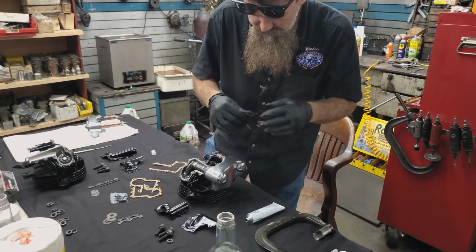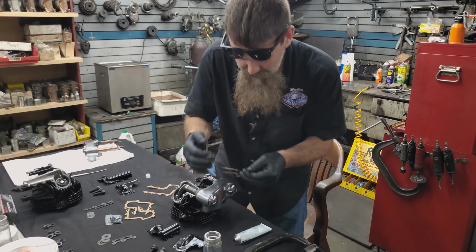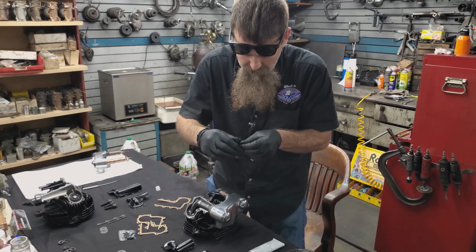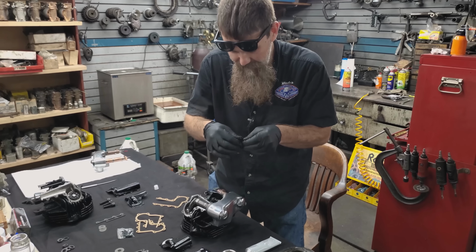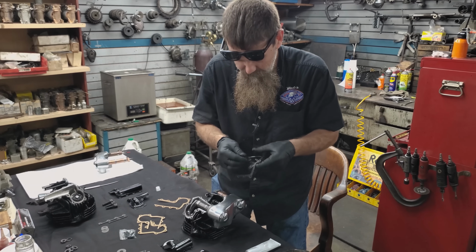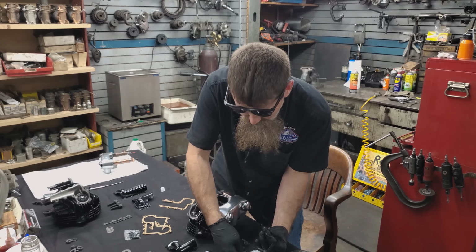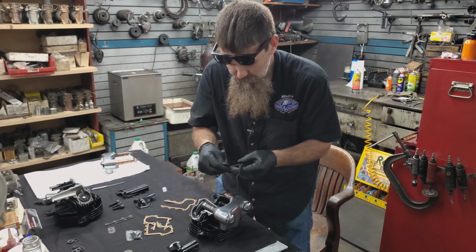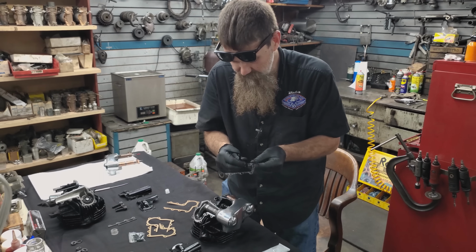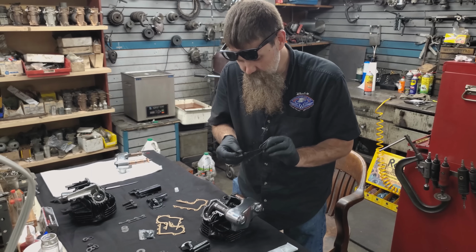It's not hard setting. It's a great gasket paste. You could actually run this Toyota black instead of running base gaskets on your engine if you've got good, clean, smooth mating surface. Wouldn't necessarily recommend it unless you get all the machine work done. But I can tell you, for sealing up a top end, this stuff works as good as anything I've ever used.